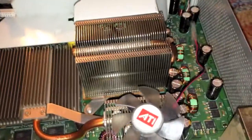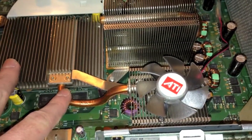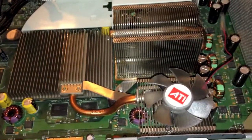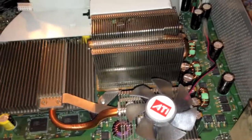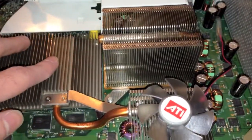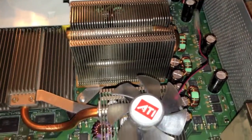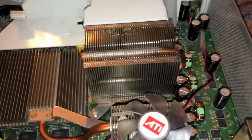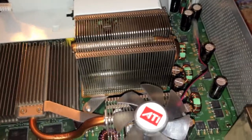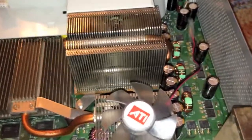The first main step you're going to need to do is get a new heatsink. If you do nothing else, get a new heatsink. Also, do not do the X-clamp modifications that a lot of people do on these systems. The X-clamps are there for a reason — they put the proper pressure on the GPU and CPU chip and hold the heatsinks on properly. There is no need to replace those with some crappy screws, because that will just put a ton of extra stress on the board and lead to further problems down the road. Do not install any X-clamp modifications, because they do absolutely nothing except harm the console further.